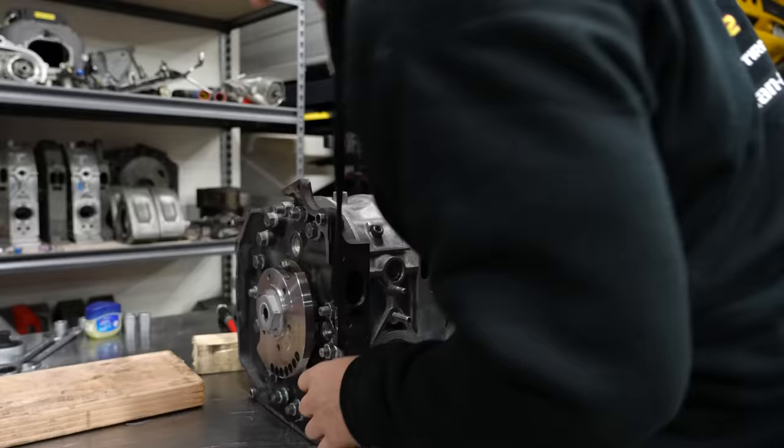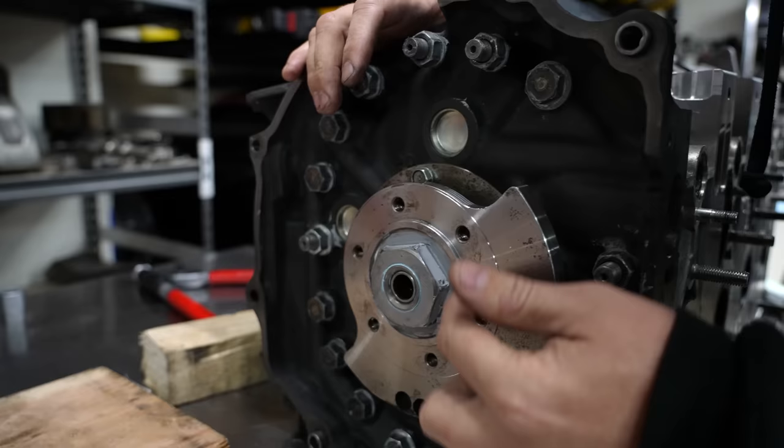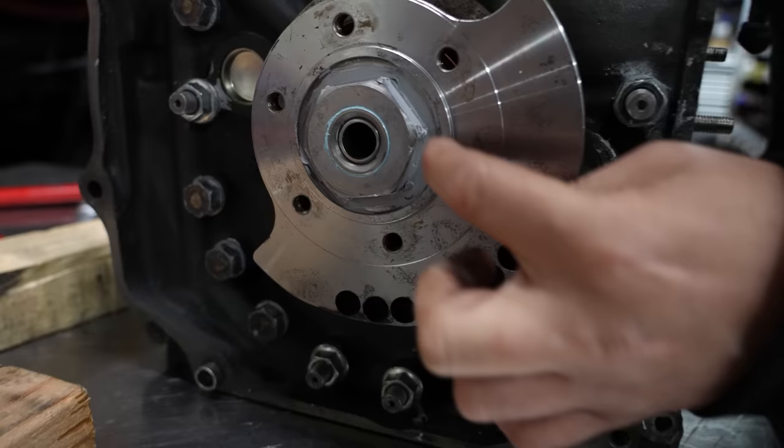Let me show you what I did to the back of this motor. I went about 7 layers deep into this. I cleaned everything off, acetone, burned anything else off. There's the splines between this and the E-shaft. I methodically put gray silicone between all of those teeth and everything, so that would prevent the majority of the surface area of oil to push out through it. I then put it on the seating face of this nut and this, and also sealed it on the outside out here, and put this blue stuff, which I'm kind of excited for using more often.